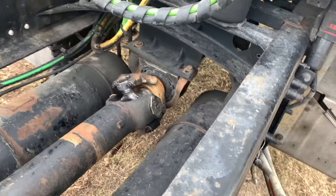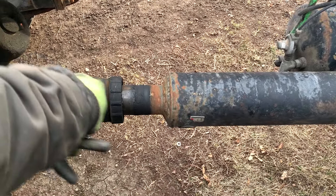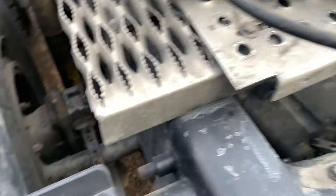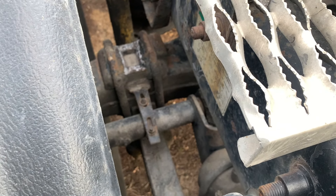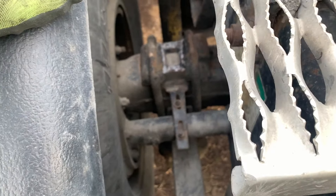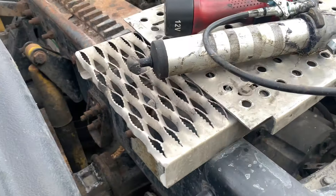We made it without running out of grease, so that's nice. I got this U-joint and this U-joint — as you can see there's grease there as it flexes going down the road. You know how I mentioned I tend to over-grease everything? The only things you don't want to over-grease: you don't want to grease the throw-out bearing because you don't want to compromise your clutch. You also don't want to over-grease your S-cam bushings because you can end up pushing grease into the brakes, and you don't want to compromise your brake shoes with grease.